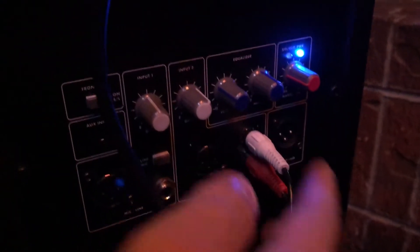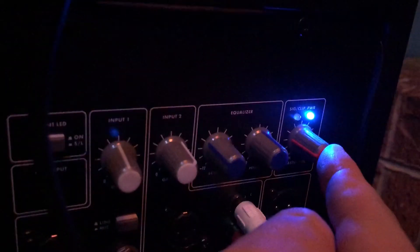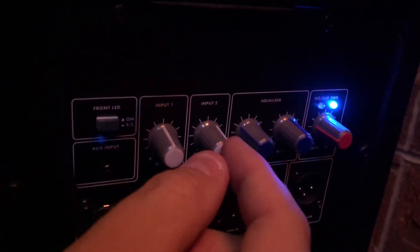If you don't have it on line in and you try to use it, you'll get a lot of feedback. The easier way, which I'm showing you right here, is you have a red and white female RCA on the back. Send that to your main house right here. I have my knob about here — I'm not up very high on the speaker itself. This is like bass and treble, so I just turn down the bass a little bit, and that is enough to blow them away at this level.